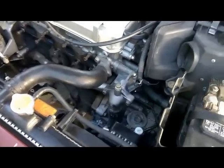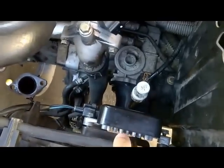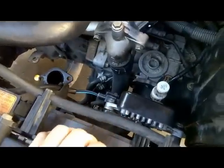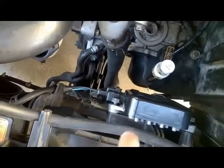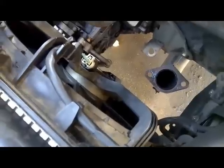I'm back at the engine compartment. I'm going to show you where the fan control module lives — it lives right here, next to the cooling fan located on the left side. So now I'm going to show you the symptom the customer was talking about. With the key on, engine off, the fans are basically operating. So far the only one I see spinning is the one on the left side, next to the fan control module. The one on the right side is not spinning. So that confirms that the customer was right.